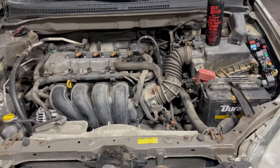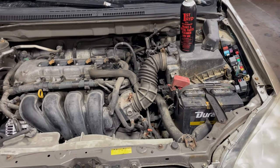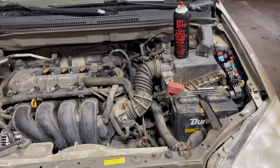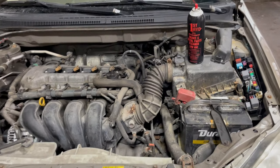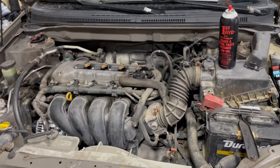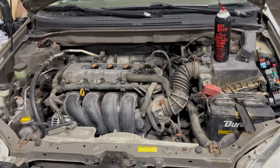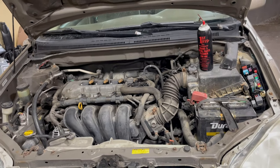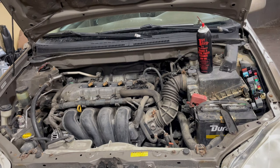That's what we did here — we cleaned the throttle body up, turned on the car, and sure enough it idled fine. We got the alternator voltage back up to 13.5 volts, and now the car starts, runs, and charges just perfectly.